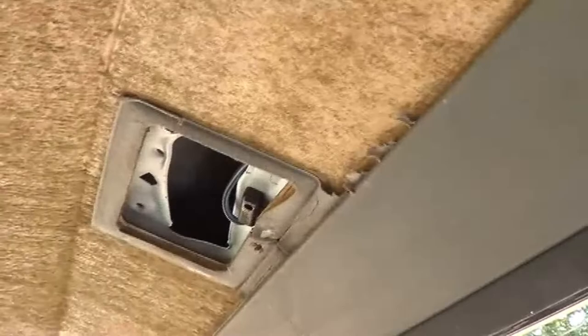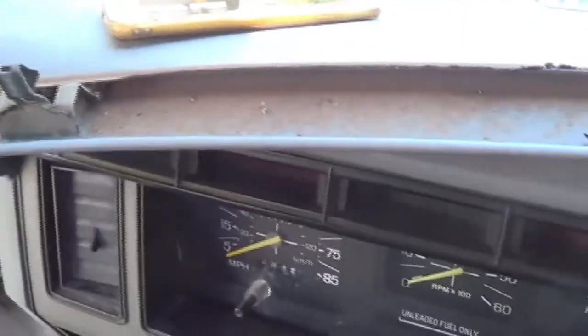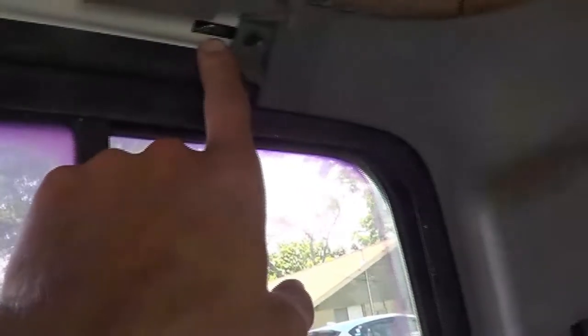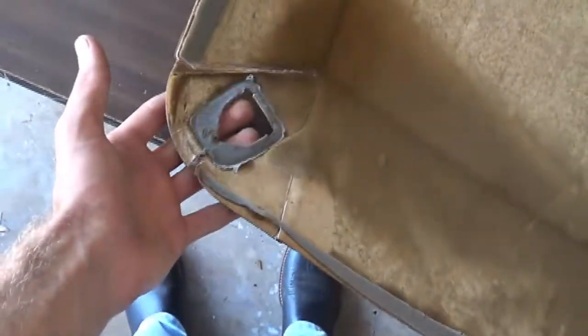The visors just come out with three screws each, and then the dome light comes out with two screws — mine only had two. To get the trim off you just pull these clips out right here; it's the same on the back. There are a couple screws as well — mine was kind of held together since somebody tried to do this at one point. Once that screw is out, this comes down and the whole headliner comes off. Be super careful on these corners — that one broke; this is 30-year-old cardboard so it's super brittle.